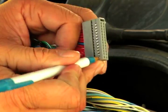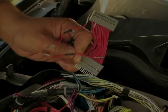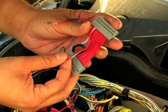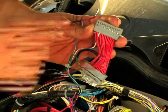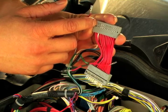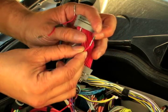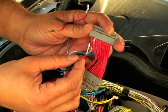You can use a pen for this. Please be very careful of these pins. When extracting them, do not apply any force whatsoever. They should slide out very freely once the retaining pin is pressed with your pen or pick or whatever sharp device you have. Be sure to pull them straight out, not at an angle. You do not want to bend these terminals because they would have to be replaced, which would be a real pain.